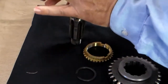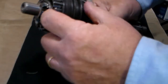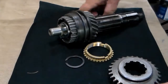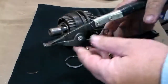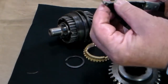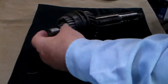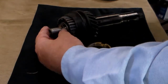We are now completely locked into second gear all the way down, but we are still missing the snap ring. To put the snap ring on, you are going to need a special pair of snap ring pliers. These are pretty well worn out, but I have been using them for a long time and they still work. We are going to put this snap ring on — I am going to probably stand it up to do so, because it is kind of difficult otherwise.